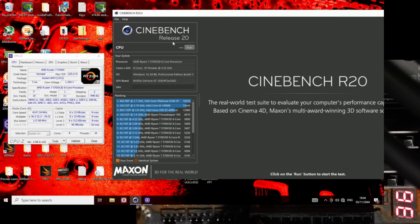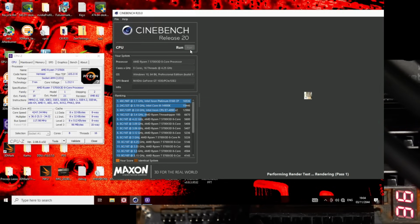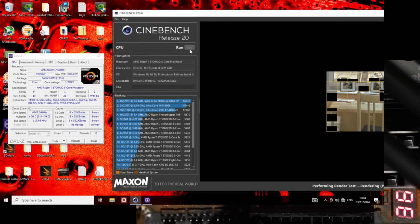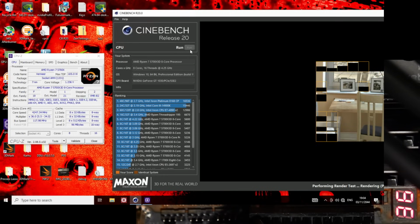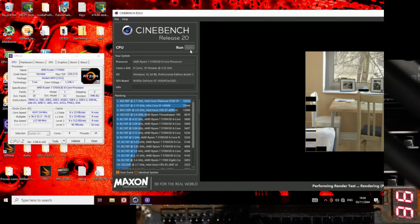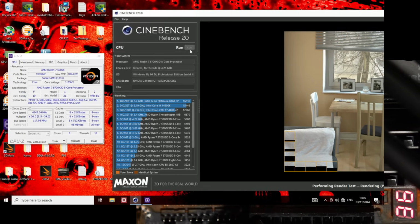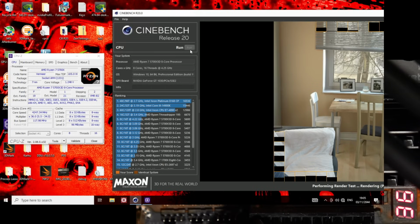I think this is actually just going to crash because I don't think we have enough core voltage. And that's basically my point: without physically modifying the motherboard, I can't raise the core voltage, right? And the thermal throttle still works in this super janky overclocking setup that I've done here. We saw that in Linpack, right? It wasn't going over 90 degrees. The core clocks were dropping. So all of the safety features, as far as I can tell, are still working.